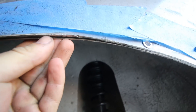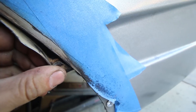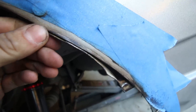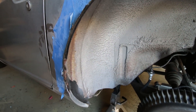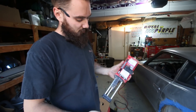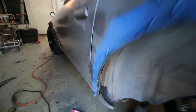I just finished cutting up the driver's side rear fender. I'll show you what we're talking about when we said it had two layers. The two layers are just right next to each other, but if you come down over here you'll see that it starts to gap. That's why you want to leave the lower layer a little bit longer than the top layer. I've already started to hammer along this edge and brought it a little bit closer. We're just going to slap a little bead of weld all the way around just to seal it back up and make sure it's nice and secure.